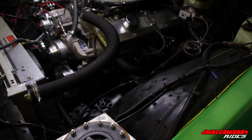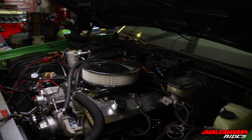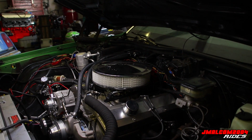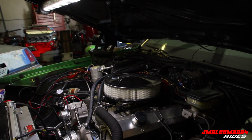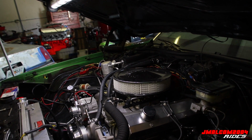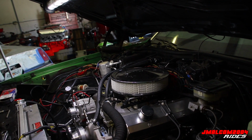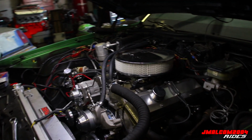I got another 5 gallons of race fuel to go in here for the nitrous. Then when we at the dyno, our last run, we're gonna pull the plugs out, put the cold plugs in there, retard the timing and take some degrees out. I think we're gonna have to take, let me think, I won't tell y'all wrong, 3 degrees out. Cause I think it's 1 degree per 50 shot. Or either it's 2 degrees per 50 shot. I can't remember. Somebody drop in the comments.